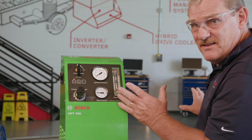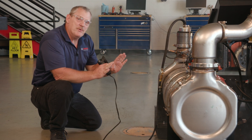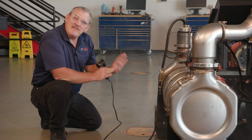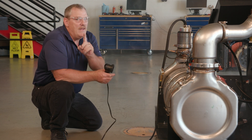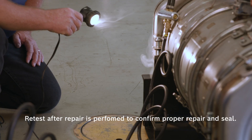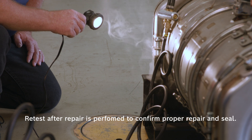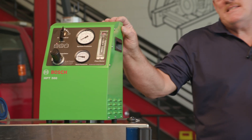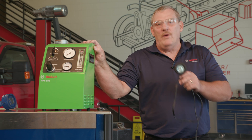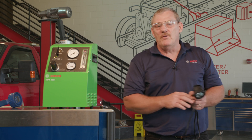Now we're going to let this sit and look for a leak. After 5 minutes of pressurizing the system with vapor, I can now see I've got a pretty significant leak at the DOC, SCR, and DPF system. That's very important for fleets — look at the size of this leak. This could cause premature DPF regenerations, costing your drivers time. You're able to find these leaks easily with the HPT500, making you more efficient in repairing vehicles with drivability symptoms that you just can't figure out. It could be something as simple as this.